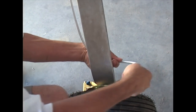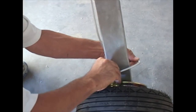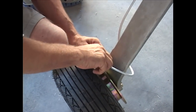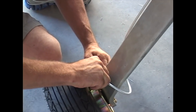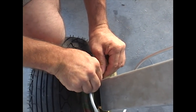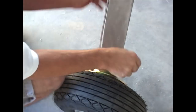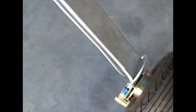Interestingly, on this RV-12 aircraft, instead of using flexible hose along the gear leg, Van's uses Versa Tube all by itself with a loop at the very bottom. This provides a nice installation that allows the tube to flex along with the gear leg, and it works out just fine. The fitting can be disconnected to replace or repair the wheel and brakes at any time, and the Versa Tube line can be replaced since it's connected at the fuselage with a bulkhead connector.